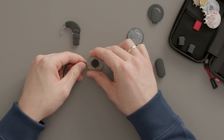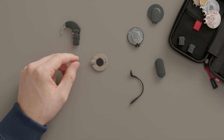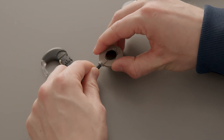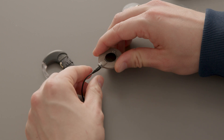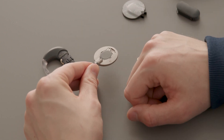Remove the old coil cable from the base and insert a new one. Note the orientation of the plug — the logo and arrow should face up. Make sure the magnet is not in the center position; otherwise the cover cannot be attached properly.